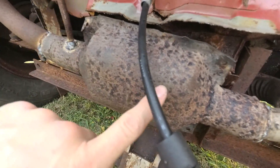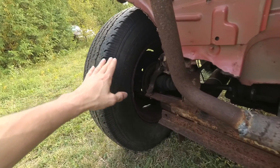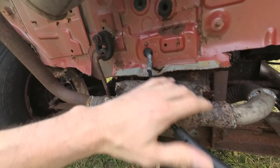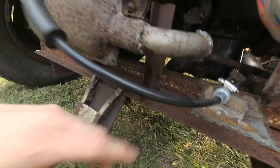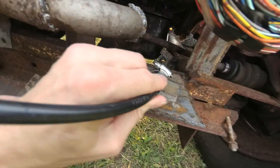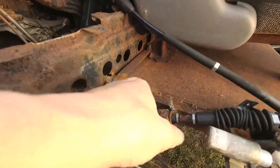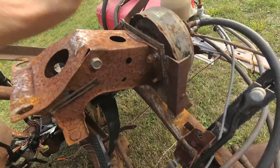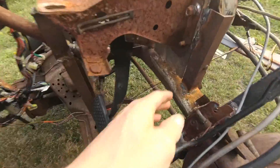And then here we have our cat, and I've just put on this old muffler. The more difficult things in this project was to route the shifter linkages. I still haven't even done the throttle yet, but taking some little pieces of plate just locks that in place. I've routed the fuel lines and brake lines from the back and they're connected to the original master cylinder and brake pedal assembly, which I've just mounted with some angle iron.